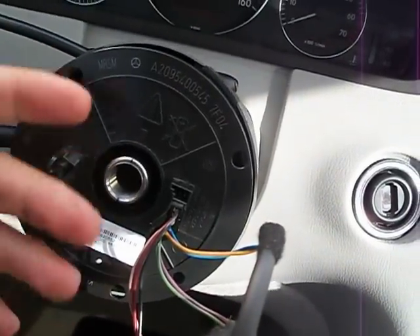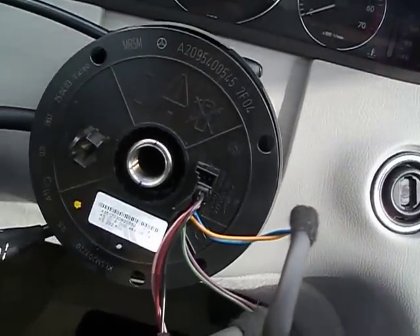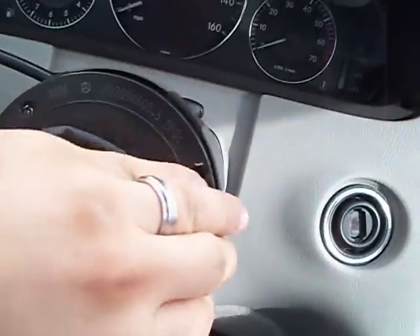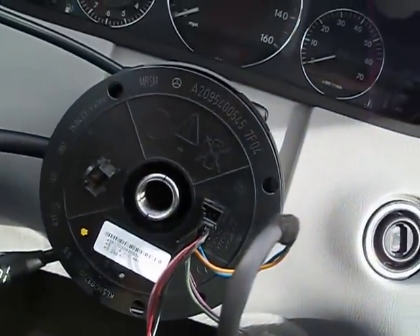It's going to say stability control is off, and you'll have more errors than that. So keep in mind the position of the clock spring — don't rotate it too many times. It has to actually be exactly where it was.